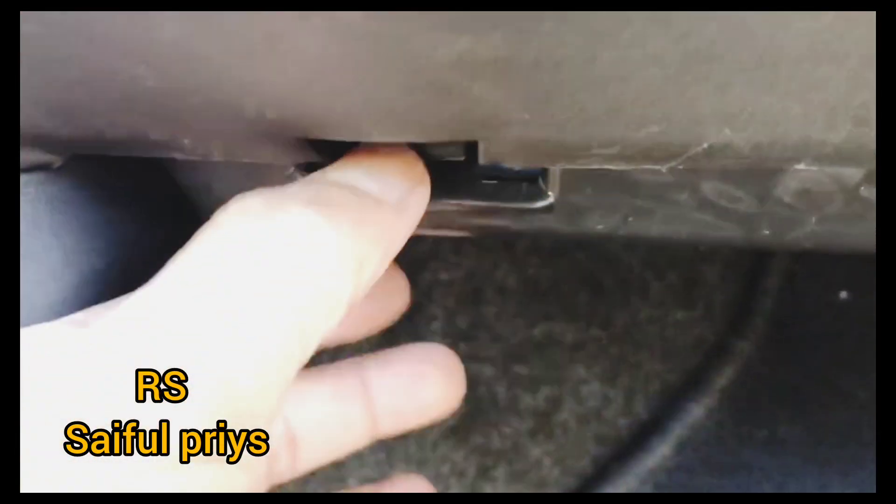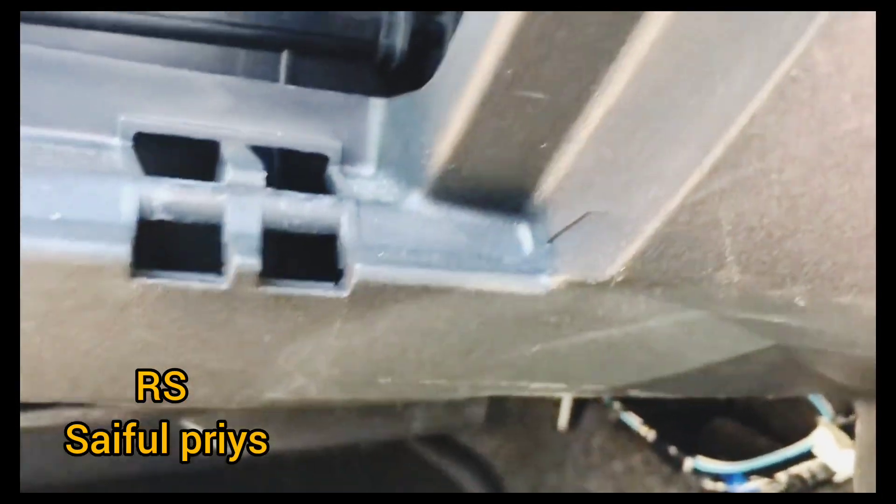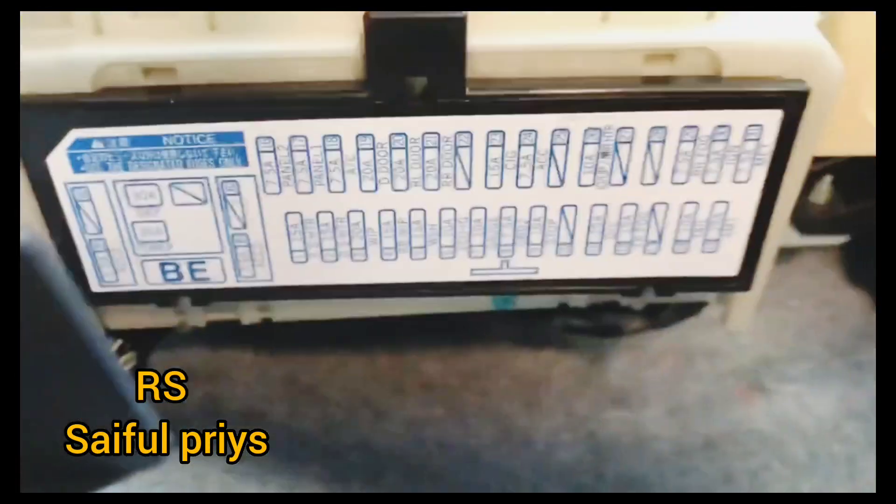When the glove box comes out, you can find another fuse box here. But the fuse you need is actually underneath there. To get access, remove this one first. There is a clip — open this one. It's only three clips actually: one, two, three. It's very, very easy. And then when you go under here you can see the fuse box underneath.